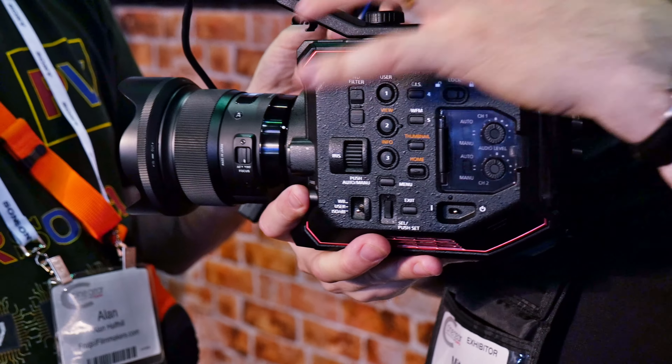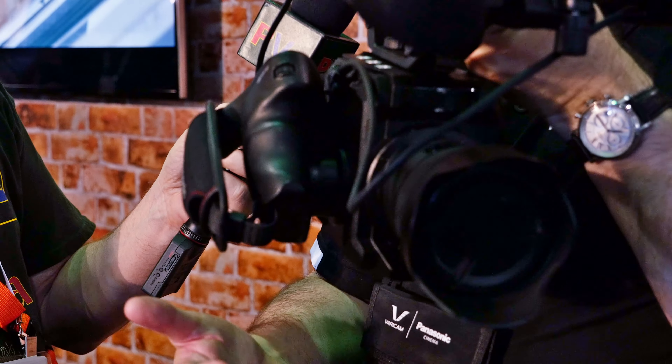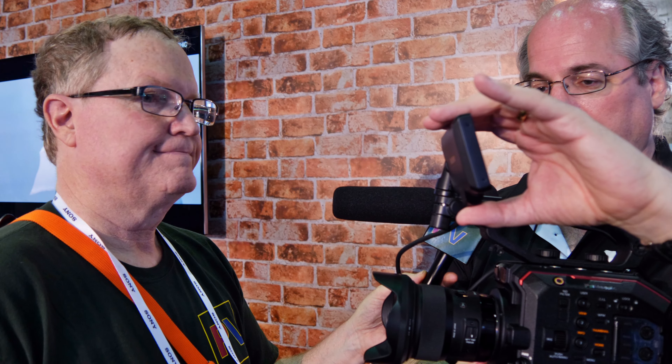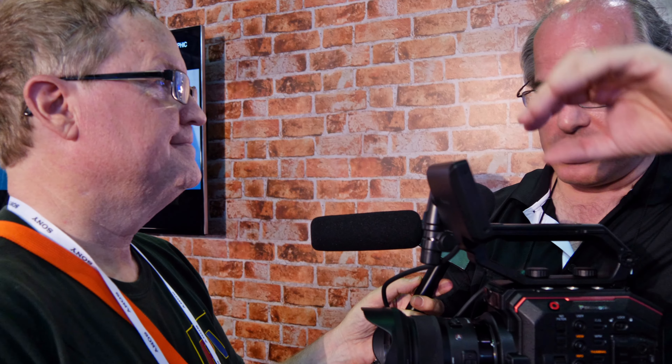It's very impressive how small and lightweight you've made this. It really opens up certain ways to work — this top handle has two knobs right here and you can take the whole top handle right off. This side grip you can adjust and move around, or remove completely. If you do that, you're talking about a really tiny form factor. You can take this viewfinder off completely, and the LCD is on a quarter-twenty mount — you can move it back here or on the other side. If you remove the handle completely, there are quarter-twenty holes right on top and you can mount the LCD right to the top of the camera body.